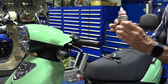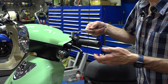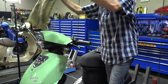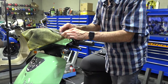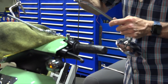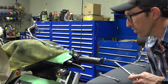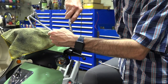You can find medium thread locker at pretty much any auto parts store — Loctite is the original brand. This is a 12mm adapter, and if you want to torque it with a torque wrench, it needs to be about 16 foot-pounds. Throw a rag over the bodywork, put a little thread locker on the mirror threads, then thread the mirror bracket on clockwise and tighten it down, getting the mirror head approximately over the grip.